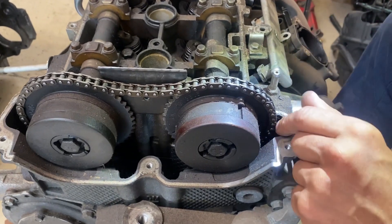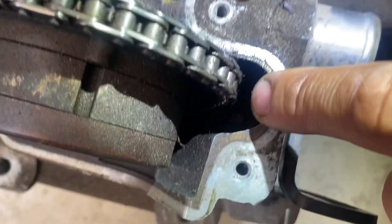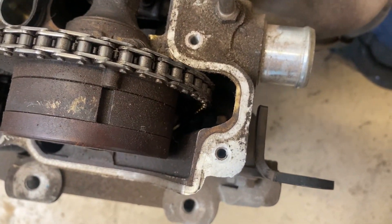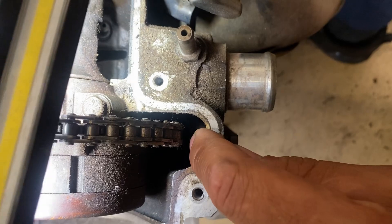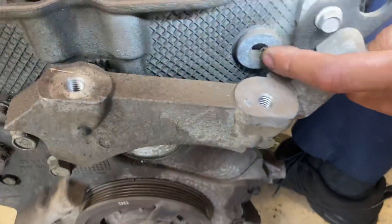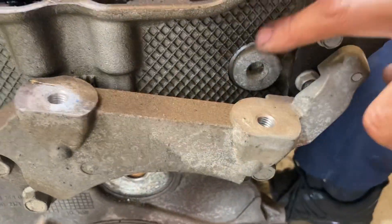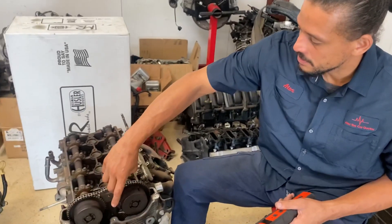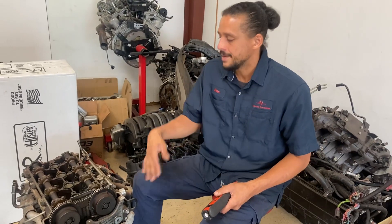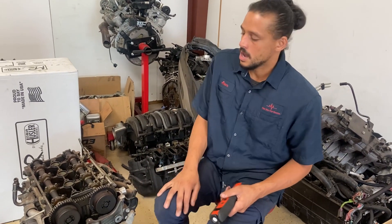The main issue I'm seeing with these engines is the guide — it's right down in this little hole. There's a guide bolt right here on this plug. You remove that and you can get to the guide bolt. That guide bolt is shearing off, basically pulling itself out of the threads of the head. So much timing chain pressure is on that bolt. These are aluminum engines and aluminum is a little soft. Once that bolt comes out, the chain will slack up and slap around real bad, and if you keep driving like that you'll have serious issues.